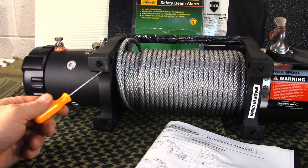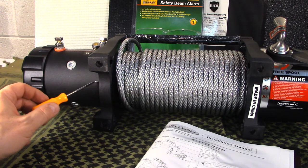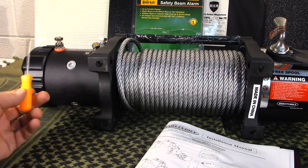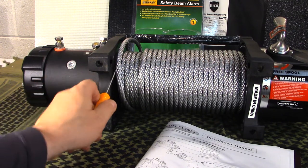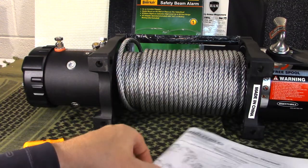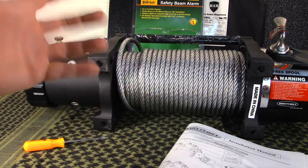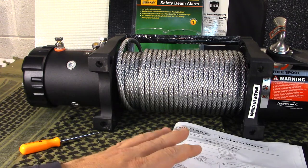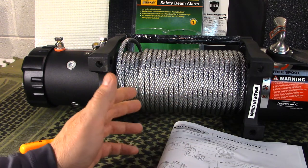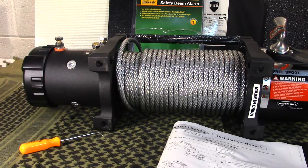I hope that's helpful. Yes, you can clock this winch, but it has those hole issues under the rubber gasket that you'll need to address. Yours may already have the holes drilled — mine did not. The guy at Smittybilt was great and said he didn't even know about it, so they're going to update their notes and possibly revise the directions. The directions are a little vague — they act like once you undo the bolts the motor just freewheels, and it does not work that way.